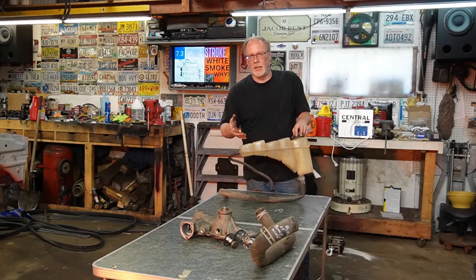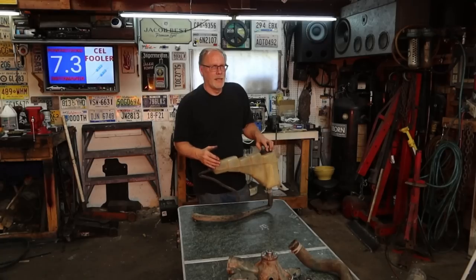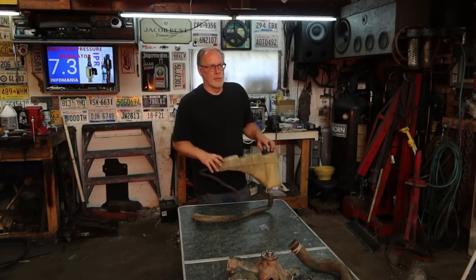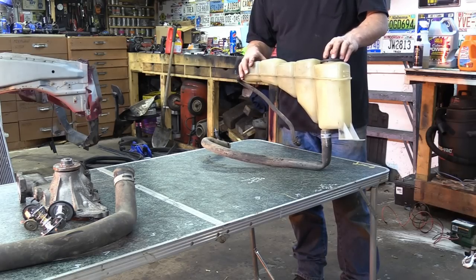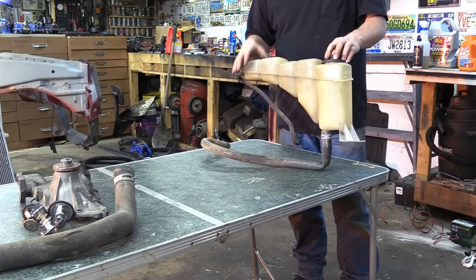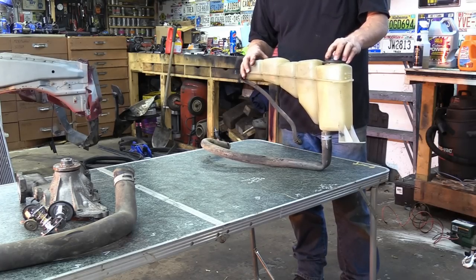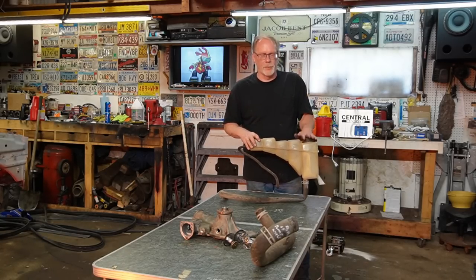That 15,000 mile interval that we were talking about, that greatly lessens itself. When that fluid gets extremely hot, it starts breaking down. And once again, it starts screwing up your cooling system, your oil cooler, the cooling of your injector tips through your injector cups, and you end up burning some stuff out, and you just sit there and go, well, geez, I really don't like the 7.3. Well, you know, proper maintenance.